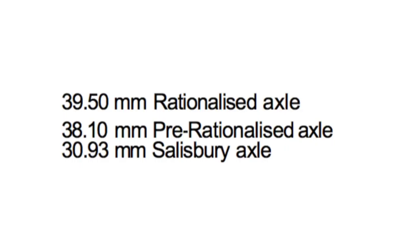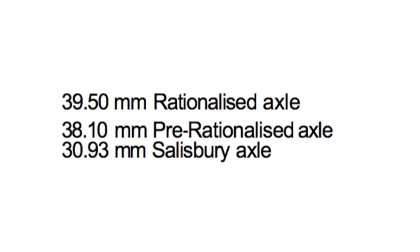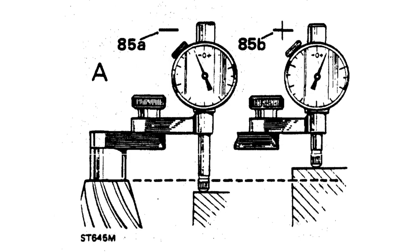In a workshop manual you'll find some figures, and it will mention Salisbury axle, a pre-rationalised axle, and a rationalised axle - this is in relation to a height setting block. The idea is that you put your dial gauge on the top of the pinion head, and then it should come to the bottom of where the carrier bearing is. These figures are actually very, very, very important that we get just right, and the only way to do this is to actually have a setting block. Regarding later axles, it will be the same thing. You lucky guys in America with older manuals can read the inches - there will be a point where we're going to have to convert inches or thousandths of an inch into millimetres, but we'll get around to that shortly. You have to know how to use a dial gauge so you can set the pinion height.